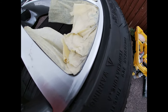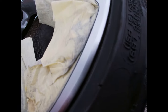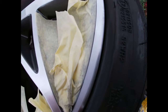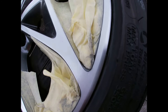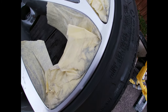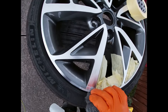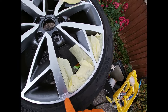Just took it off the head cam to get a close up. Now the problem you've got is the bare alloy that you've exposed looks different to the polished face, and because there are layers there, there's actually an edge. So there's a little trick to hide this — we're just going to scotch the area, going a little bit further than the bit we've sanded back.